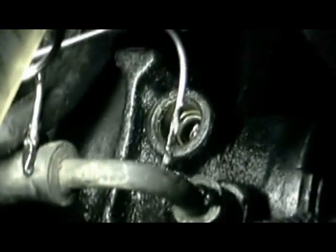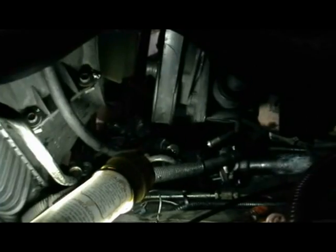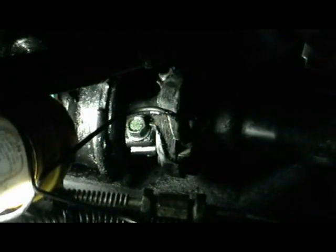Okay, we'll just hook our power steering pump lines back up. We've got those two, and we've got the main feed line from the reservoir, that hose from the reservoir, and the two cooler lines. Of course, you'll have to hook up the steering shaft before you even bolt the box up. So it's pretty elementary. You just keep your wheels pointed straight forward, and the Pitman arm in a straight position. It's got a flat spot on it and only goes on one way. So you hook the bolt up into that, tighten it up, and then you can secure the steering box back to the frame, and then install your cooler lines. Or not cooler lines, but power steering lines.